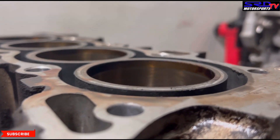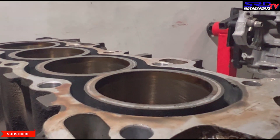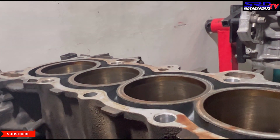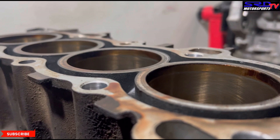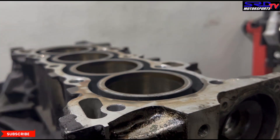Let me turn the block and show you the bore. Remember, these pistons were rocking at top dead — locally they call that 'may i log' — but look at that crosshatch! That is a 22-year-old, 97,000 kilometer motor and it's still fresh. So why are you needing oversized pistons?